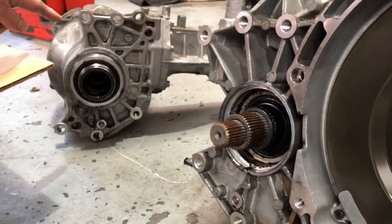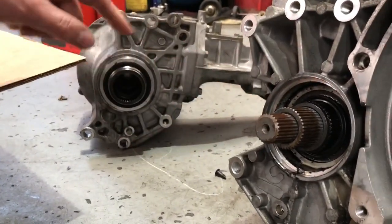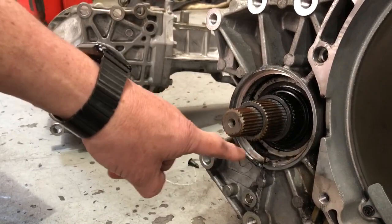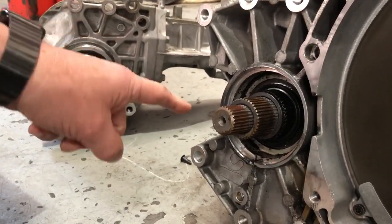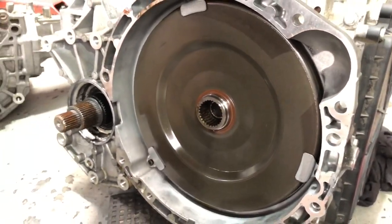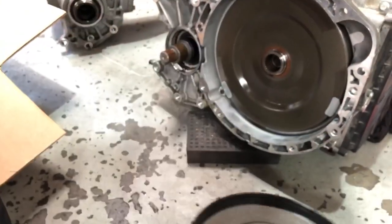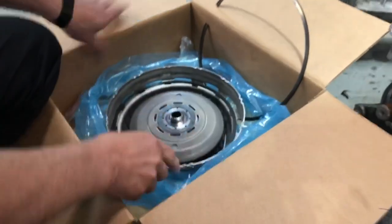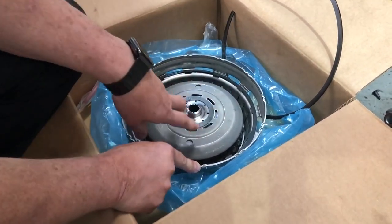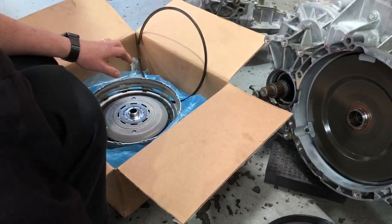Some people call this the 90-degree drive, some people call it a transfer case, because inside here is another differential. You can see this assembly here is actually a stepped gear which fits into this location with these three steps as well. There is quite a complicated oil seal mechanism between this part here where it connects to the four-wheel drive transfer case, and if it's not assembled correctly it can also cause leaks — in the case of this particular one, it does. I've got one of these out of another transmission — this is exactly what the cover is, basically a big fry-pan dinner plate that sits over the top of the clutch assembly. In behind all of that is the basket assembly and the clutches, because this is what drives the car, the stepped clutches for the dual clutch transmission.